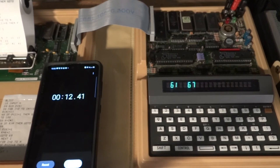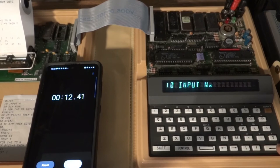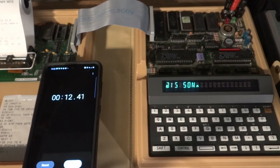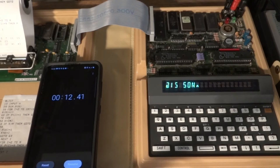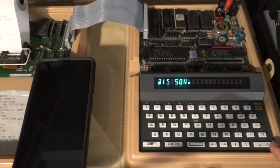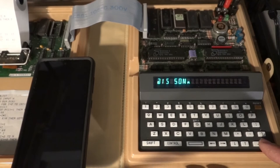About 11 seconds — I was a second late. There's a trick to make it faster: similar to the ZX81, most of the processing time is spent scanning the keyboard for input and driving the display, even if there's nothing to display. There's a statement that allows you to turn off keyboard scanning and the display — similar to FAST and SLOW in the ZX81. With S ON, that means speed on — fast mode.